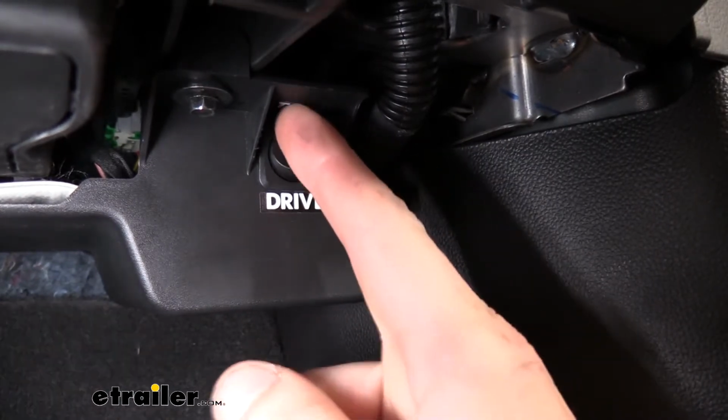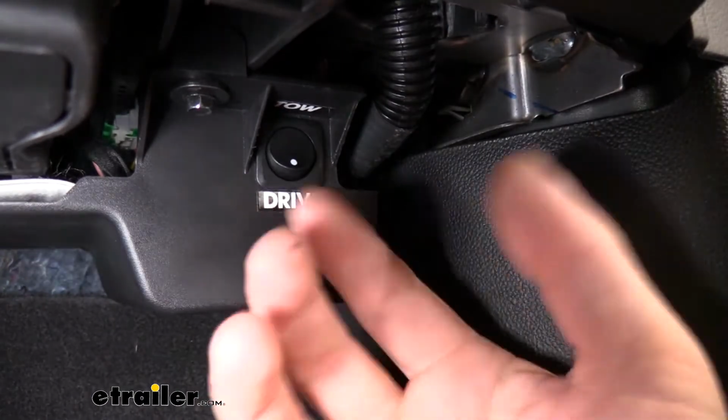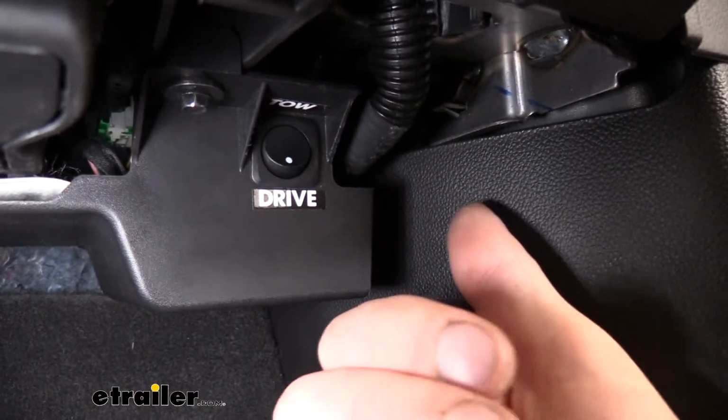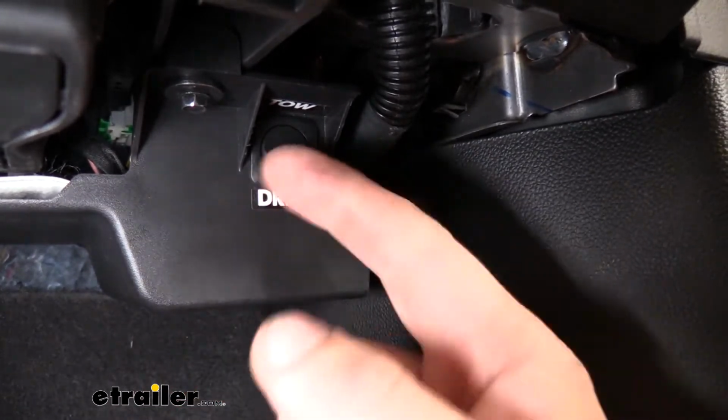With the push of a button here, we hit the button and you saw some lights kick out because it removed two fuses from the body control module circuit that is specific to our Buick Envision here, but there are other vehicles out there that require fuses to be disconnected when flat towing.